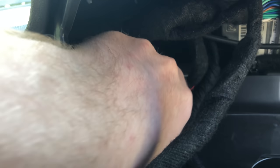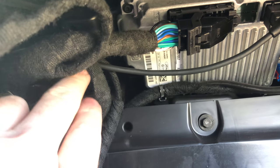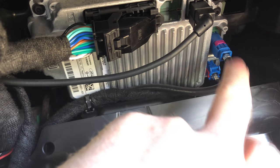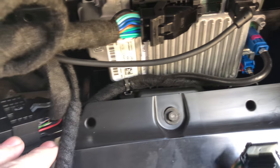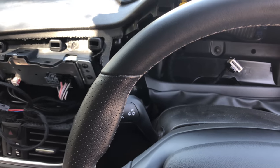I might use cable ties to secure it. One thing to watch is not stressing the cable too much since it's taped to the original loom. A quick tour: nameplate main connector, another connector, what looks like an HSD going to the screen, and another small connector. That's all tucked away — this is where the instrument cluster sits. Now I'm going to plug it all back in and pray my car still works.